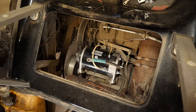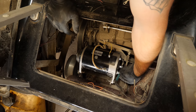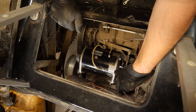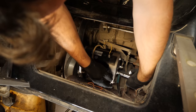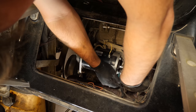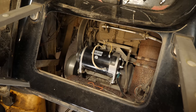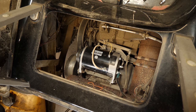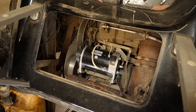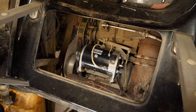Let that cool for a moment. Now we'll install that on the stud with our lock washer and our nut. There's still a lot of cable here. I can't find my short 10 millimeter socket so I've got to use an extension — okay, there we go. See — much different. Now it is going to have a little bit of a whine to it until it breaks in. After the brushes break in and are cut in properly, it will start to quiet down. Let's see if it'll start. Look at that — that definitely solved our problem.